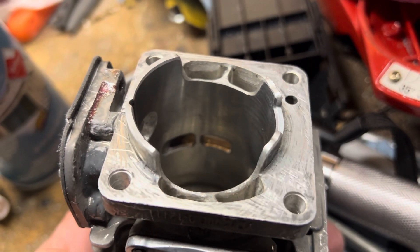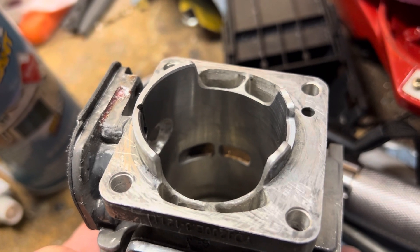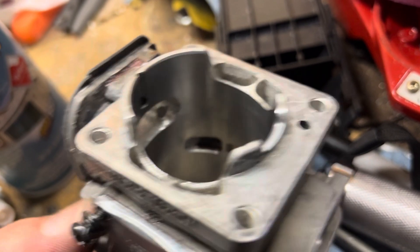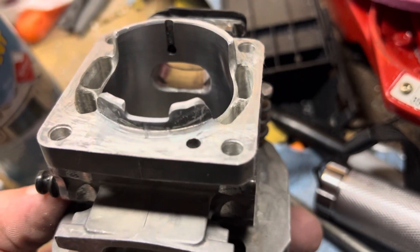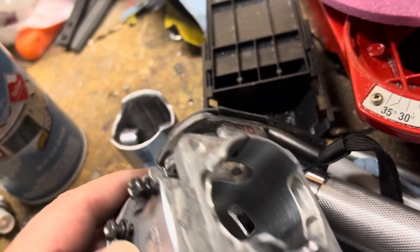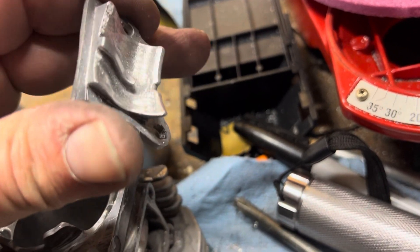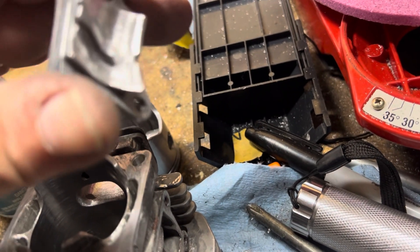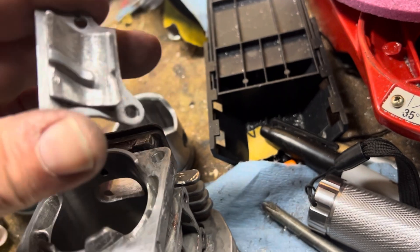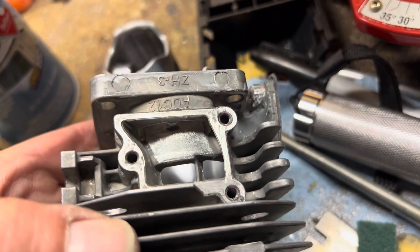Transfers are at 125, so blowdown's 19. I purposely went a little less blowdown on this. I did grind the caps a little bit on the ends there — they were hanging up higher than the transfers, so I did all my work through in through here.